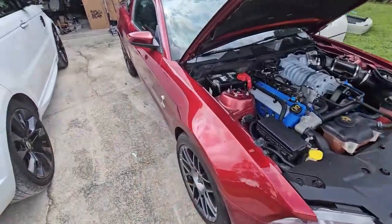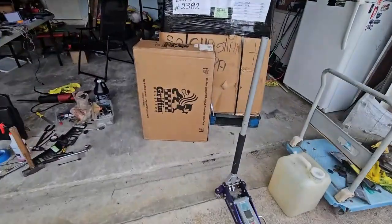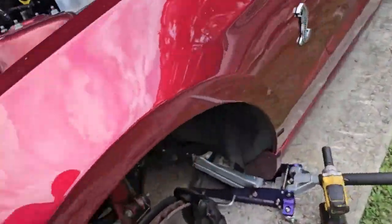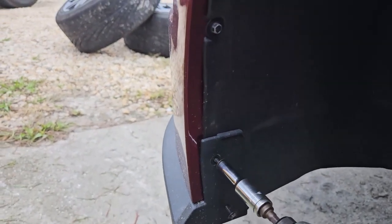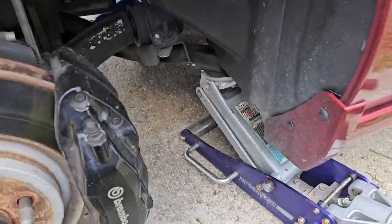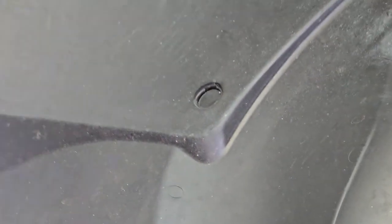The 2013–2014 GT500s have the most space because of the grille and some of the openings, diffusers, and things like that — so we'll see what we have to cut and what we don't. Here is the exchanger. I popped the front wheels off and removed these three 7mm bolts on the passenger side; I'm going to do the same for the driver side. Then I can pull back the splash shield to get to the bumper bolts. Make sure you keep all your stuff together.